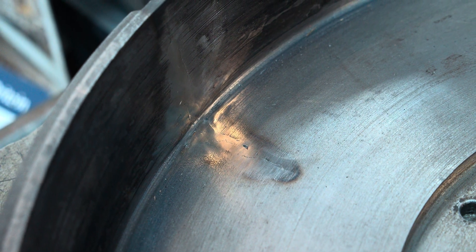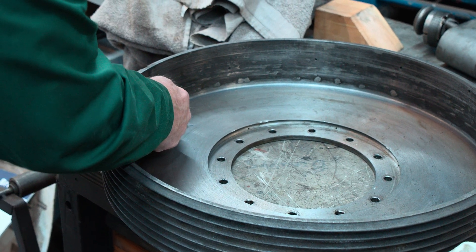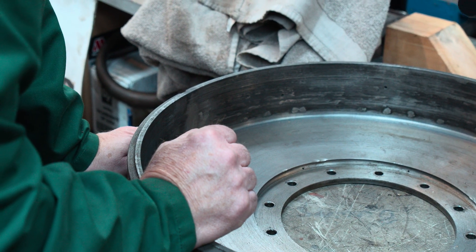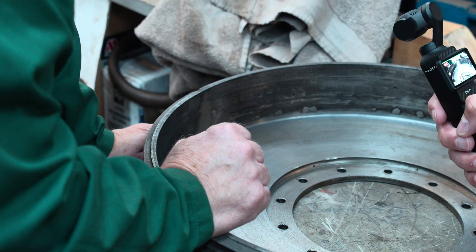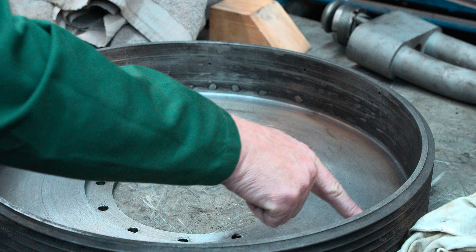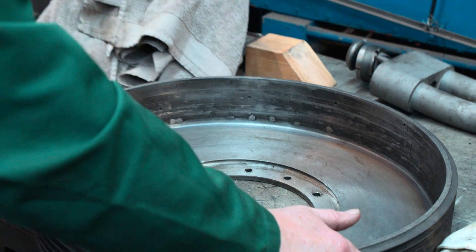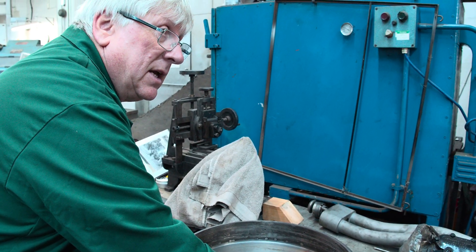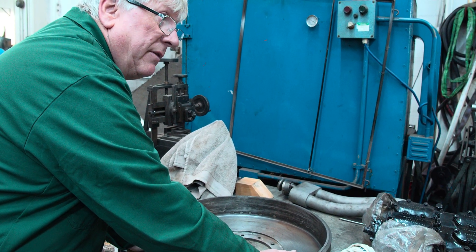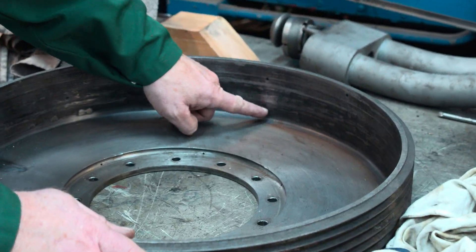We found a crack within the brake drum. It goes all the way along there then up the side as well. We can't understand why it's happened, but if you look at the coloration of the drum in here you can see the discoloration there — that's all to do with heat, and that must have happened when it did its run because it hasn't done any work since. The drum got very, very hot, and you can see inside the drum here there are these little marks on the cast iron.